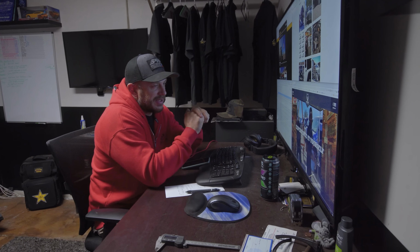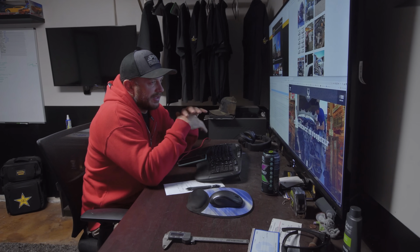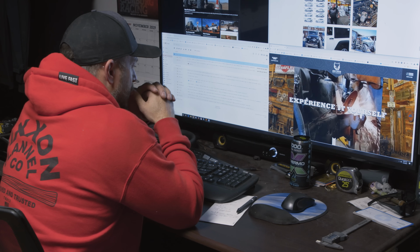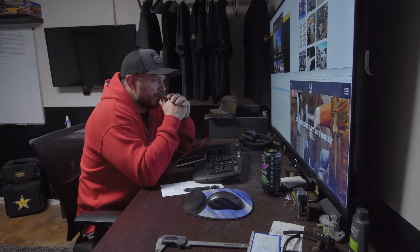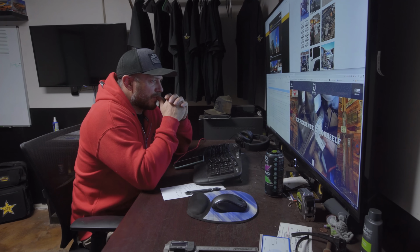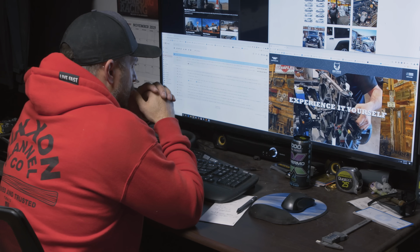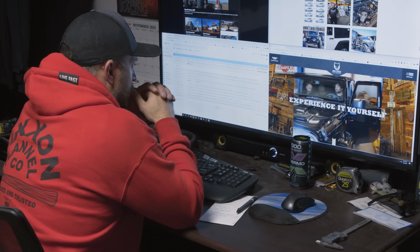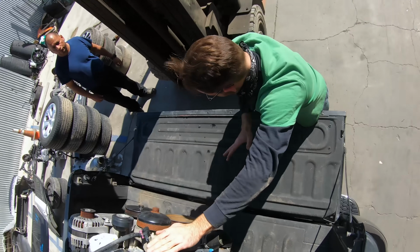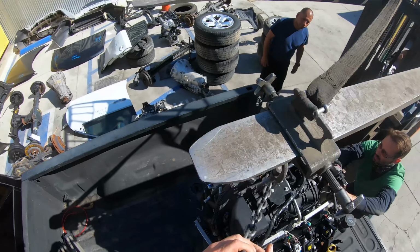This is an automatic transmission, so shifting, TCM, ECU, all those things, what do we do there? Because obviously it's not all the same. So this particular platform is what we call the fully tunable platform, which means that you can do any type of tuning, cam changes, turbochargers, superchargers, whatever you want to do, as long as you have HP Tuners or something of that nature, to where you can get in and tune the engine. Okay, so I'm probably just going to give you my gear ratio, my tire size, all that kind of stuff. And when you program all this for the first time, you're going to input all that data.